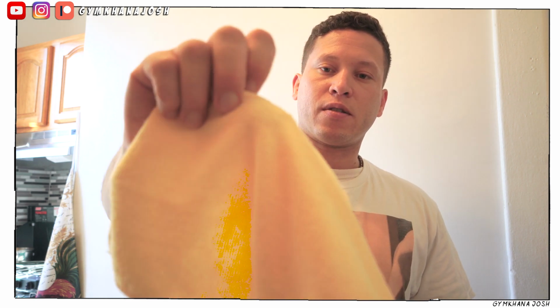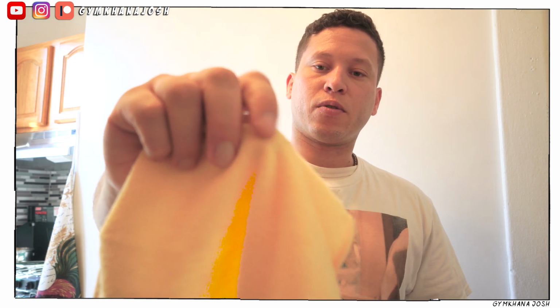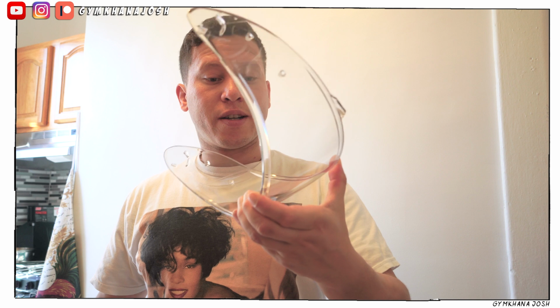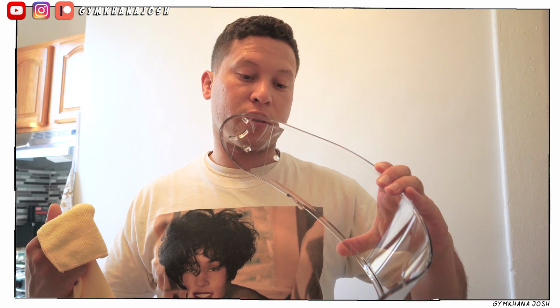And then I dried it off afterwards with a microfiber cloth. If you can see, these are kind of a special surface to dry off different items, plastics, glass, stuff like that. And it's not supposed to leave those fuzzy strands, the fiber left behind. It's supposed to be completely clean. So now I have my Transitions visor, trying not to touch the actual surface that the anti-fog insert is going to go onto. And now I'm going to take the anti-fog insert out of my factory visor.